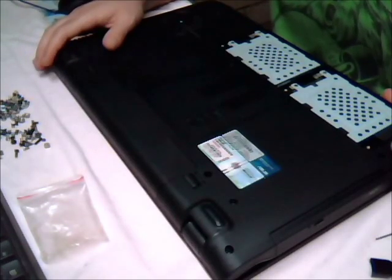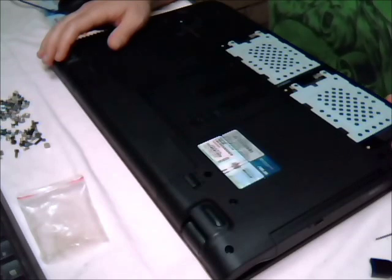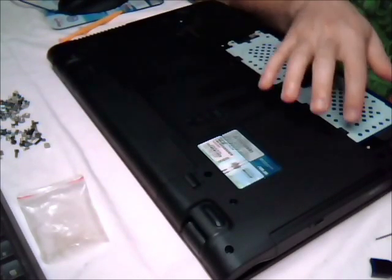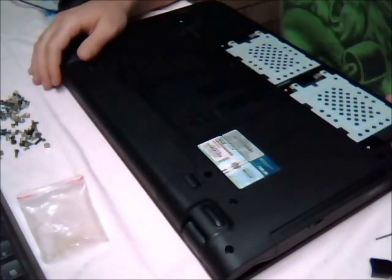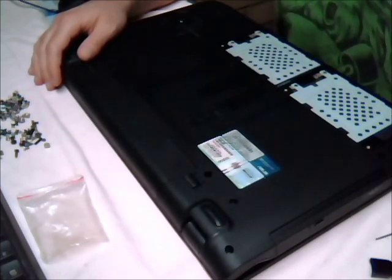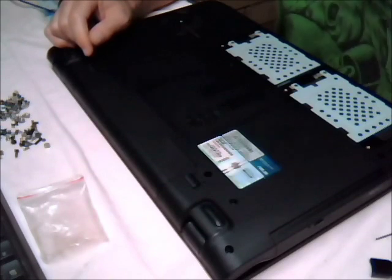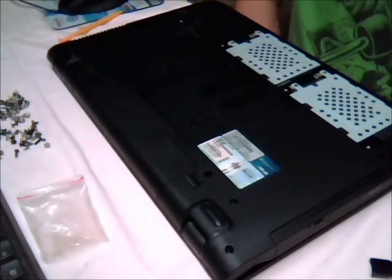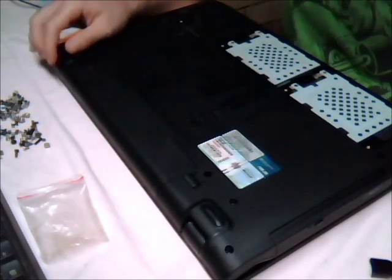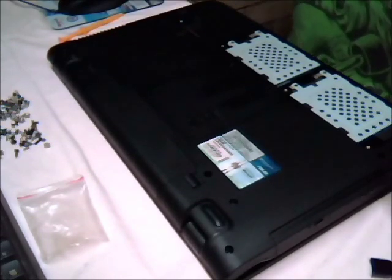That's pretty much it. Once you've assembled your laptop back together, you'll store your hard drives into their caddies. The SSD didn't include the screws for the caddies, so I had to use two of the screws on the primary drive. There are two vacant screws there and two vacant screws there, so I'm going to have to chase up four screws — I think they're 2.5mm by 2mm, but don't quote me on that; it's just a very stubby screw. You'll also need to get another two screws in some of these holes. Thank you for watching the video.